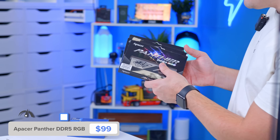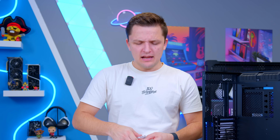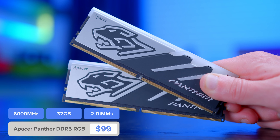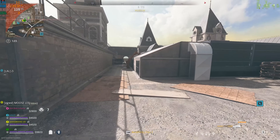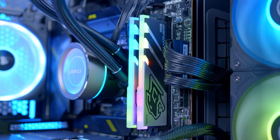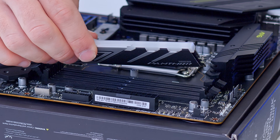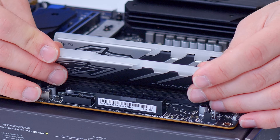As far as the RAM goes, I'm going to be adding in the A-Pacer Panther DDR5. I haven't used A-Pacer's DDR5 before — it's two 16GB DIMMs packaged separately, but we'll give it a go. 6,000 MHz. You are going to struggle to go too much further than that on this board anyway as far as RAM XMP speeds go, and for gaming performance this is going to be more than adequate. As far as matching with the build theme, this kit is going to do us really nicely. It is black and silver, so accent-wise it kind of fits perfectly. Installing in the second and fourth RAM DIMM slots for the Panther memory — quite low profile as well, so certainly very easy to put in even with large tower air coolers.